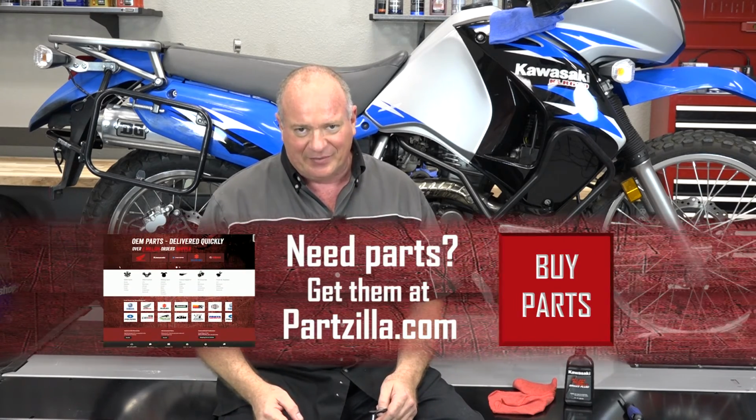Well, all right, guys, that pretty much wraps this up. Listen, when should you go through the brake bleeding process? Well, I'm going to go ahead and tell you, at least do it once every year and or when you replace your brake pads. Why every year? Because brake fluid is what they call hygroscopic. That means that it attracts water. And the last thing you want to do is get water into your braking system. It would not be very kind to it.